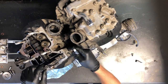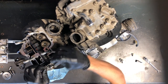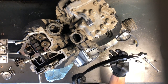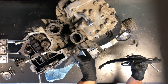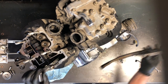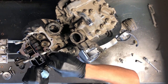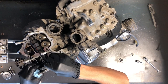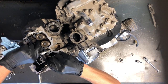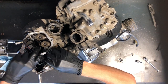The tensioner is here, so you got to use a wrench to get in there. This will help us pull that cam chain and camshaft off. There's one up at the top as well that holds that cam chain — you can see when I'm turning that, it's attached to that guide there. That'll allow all kinds of free play when we have that removed, and there's your cam chain tensioner. You have two bolts — one right in the side of the cylinder head, one right in the side of the cylinder — those are attached here. Pull the tensioner bolts before you remove the cam chain sprocket; it makes it a little more simple.